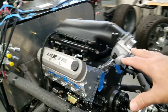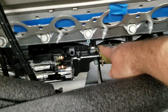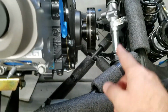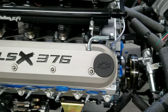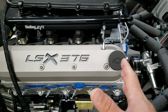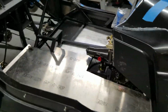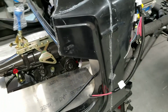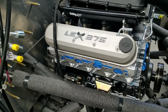We need to take the lift over there, get this engine mounted, remove the wheels and tires, and start floating this thing. And then we're going to get this webbing figured out, then get all the spacing here figured out. We are going to get this finished, get this harmonic balancer on correctly, and then hopefully have this engine back to its original position that it should be in, which will give us clearance for our drive system and clearance over here. As I say this, it seems like it's only a few steps, but we're floating a 750-pound engine in a tight space.